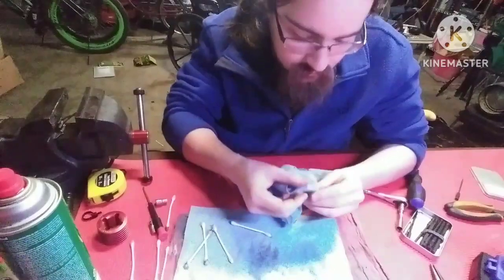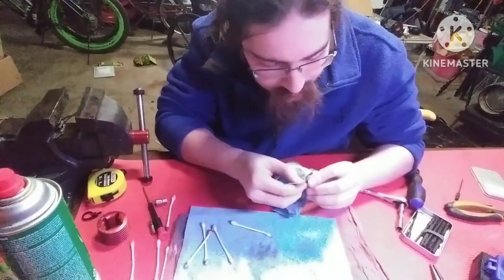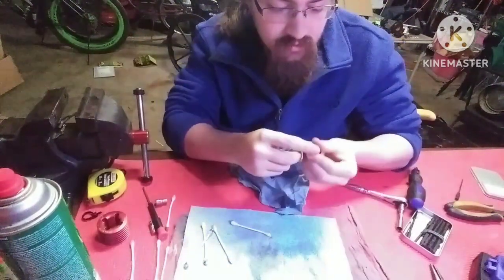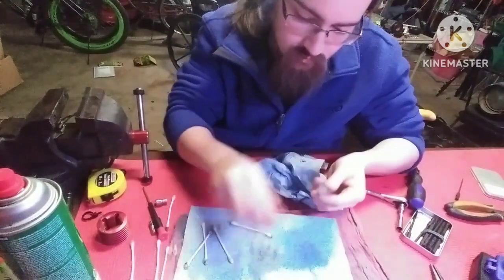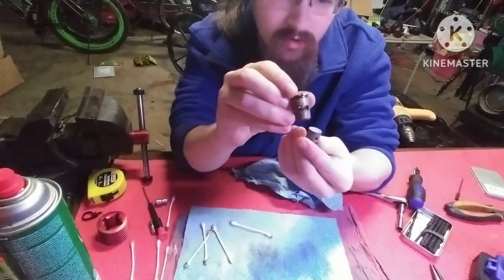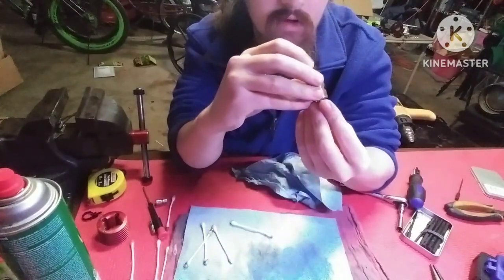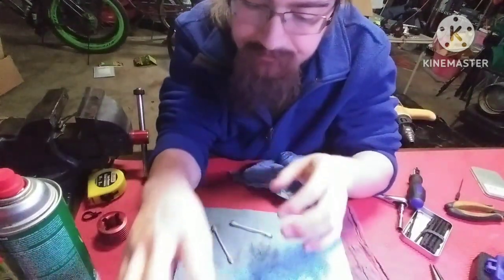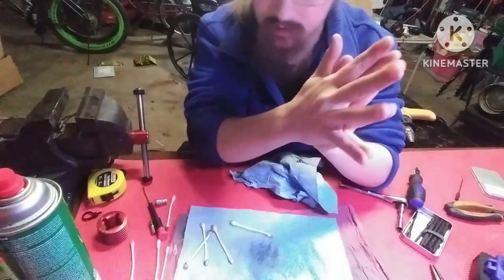Make sure you get the top of it all nice and clean, because you can get, like, natural gunk stuck on top of the head of the piston. So, again, you can line the exhaust port window and the skirt cutout together, and put them back. Now that's cleaned. I think at this point, we're ready for reassembly.